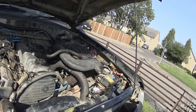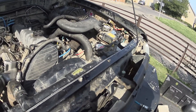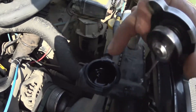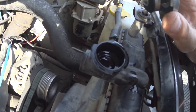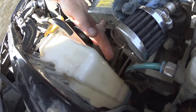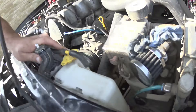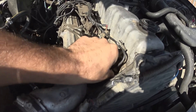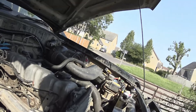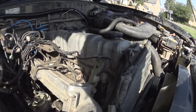So we obviously took it for a drive last night — we'd done part one of the bleed. Today we're going to check the level and pull this out again. It's still at the top, which is good. Which means whatever it needed, it must have taken out of the tank — which was here and is now here. So it's taken maybe a couple hundred mils out of there. So all I should do is whack that out again.